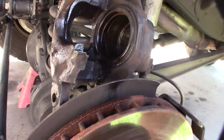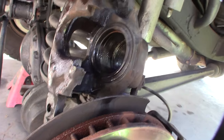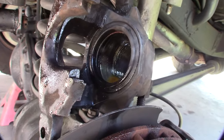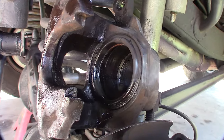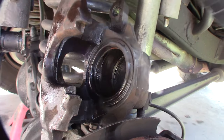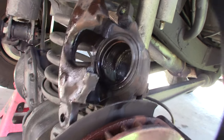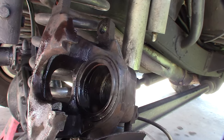There's a little bit of pitting but it's barely on the outside — what really matters is right here where the seal contacts the piston. You can see the debris I drained out — right there. I'm pretty sure that debris was binding the piston sideways. I'll clean it all out with paper towel and then blow it out with the compressor to get the fine particles.